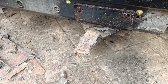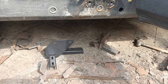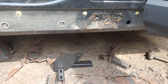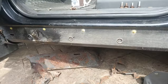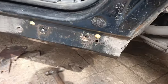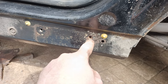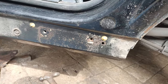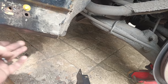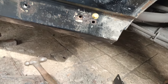A bit of WD-40 and a good socket and hopefully they'll come off. That took long enough, but they were there. There were a couple of seized bolts, but most of them came out okay. This one at the back was the worst one - the threads in there are rusted through, so what I might do is run a tap just to clean up the threads. The one at the front's not too bad, and the two underneath they're pretty poor as well, so I'll see what I can do just to neaten them up.